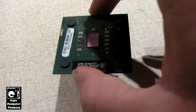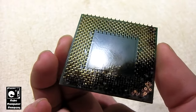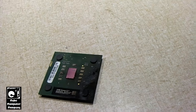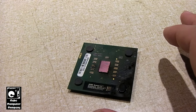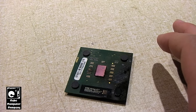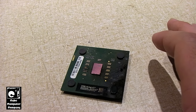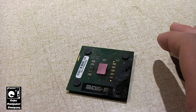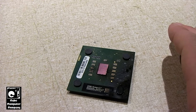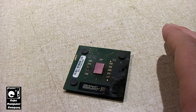You can see it got burned up real nicely here on the corner especially. It was just a matter of relocating this chip into a different spot in the microwave because this microwave is missing a turntable. Items don't always get the best microwave energy because microwaves are about 12 or 13 centimeters in length for a single wavelength, so there will be dead spots — which is why most modern household microwaves have a turntable. Older microwaves that didn't have a turntable had a wave stirrer that was sometimes hidden up in the roof of the microwave to balance the microwave energy around the cavity.